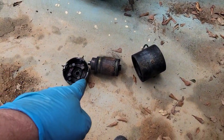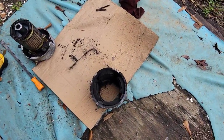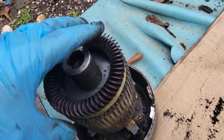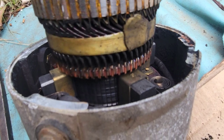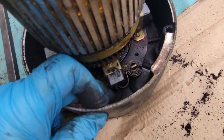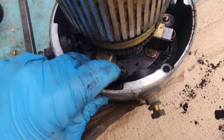Not really fixable anyway because I couldn't get the armature off without damaging it. So let me walk you over here and show you the used motor I got to go on it. I took it apart to inspect the brushes and blow all this carbon dust out. Do you see all this dust in there? There is so much in there. But this armature looks good — nice and clean, especially down where it rides the brushes. Look at how big these brushes are — they're pretty clean. The whole plate is good and clean. I can move the springs. I can move the brush — see? That's how I know it's not locked up. They're in much better condition.